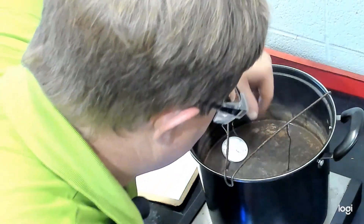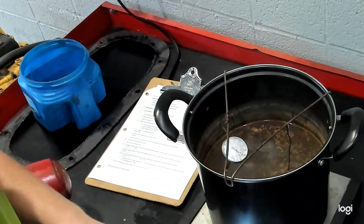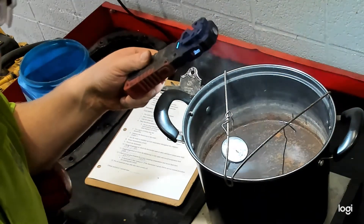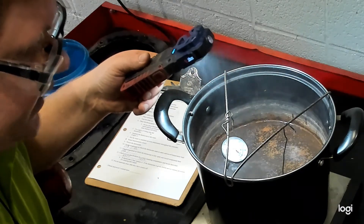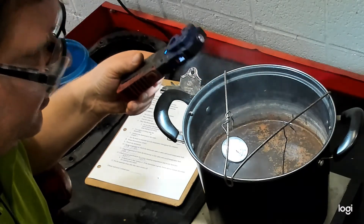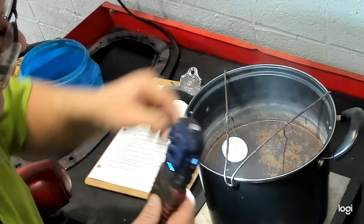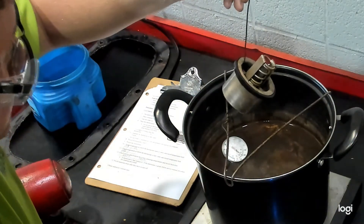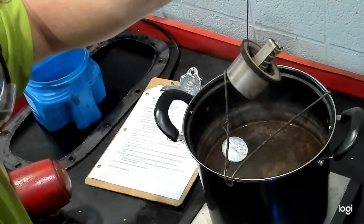We are up very close to 200 degrees at this point. When testing thermostats, it's not going to be possible to get the water hotter than 212 degrees — that's boiling. The thermostat should be open well before then. If your thermometer does not read 212 in a boiling pot or very close to 212, then it's likely that your thermometer is off and not accurate. Also, it looks like the rubber seal is actually moving down with the housing — if you squeeze that up, you can see a little more of the opening through there.